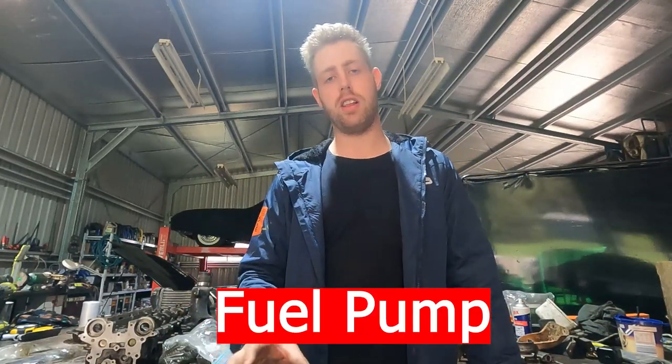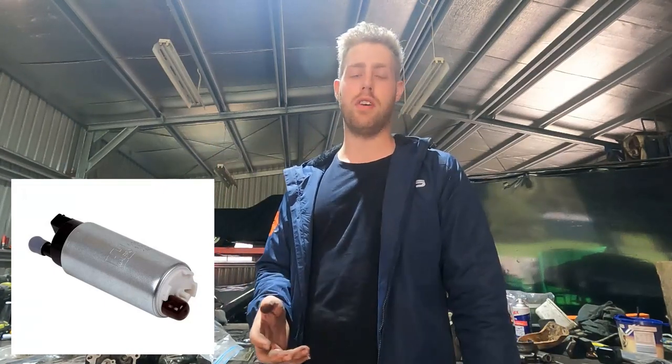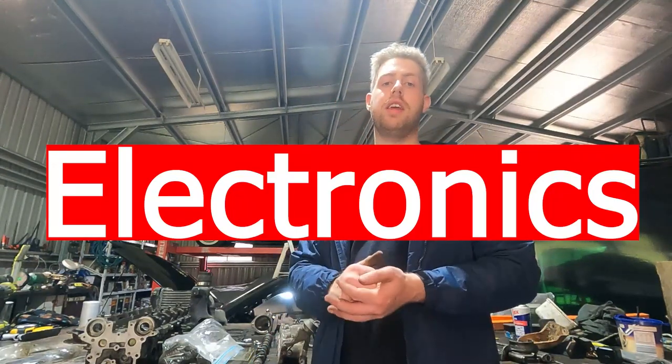The fuel pump is also in the fuel tank. Like the rest of the car, these pumps are 30 years old — if yours hasn't failed already, it probably will soon. At minimum, staying on pump 98 fuel, look at a Walbro 255 — good for 300–350 wheel horsepower. I'm running 300 horsepower on my CA and the Walbro 255 is just about capped out. They're reliable and cheap. Also note: with a stock fuel pressure regulator, don't fit a Walbro 520 — it can't handle that much flow and pressure. A Walbro 460 is probably the maximum with the stock regulator.